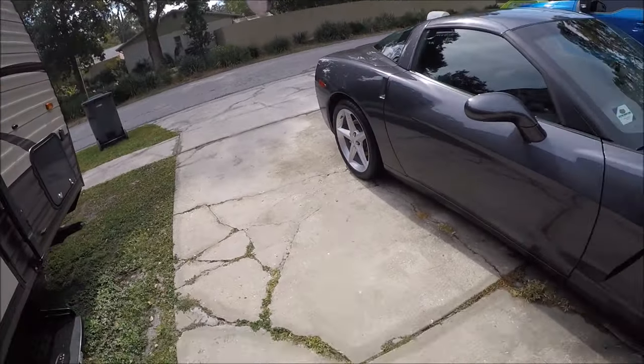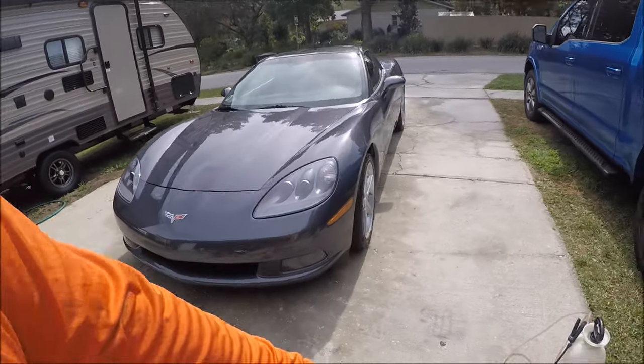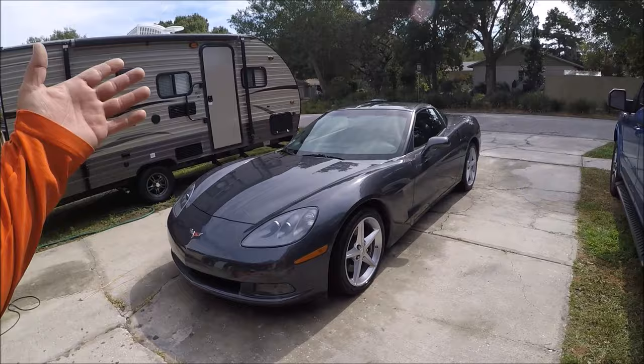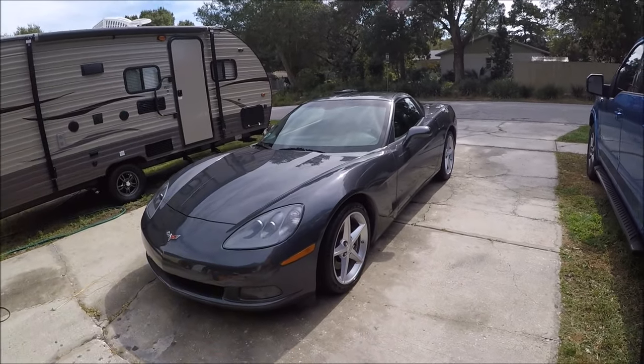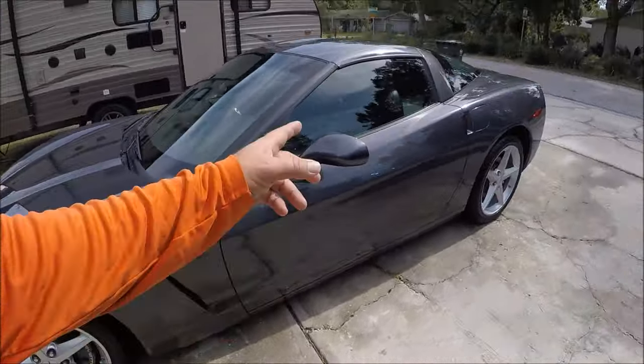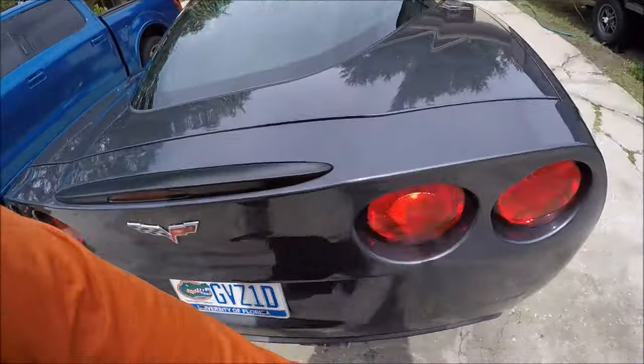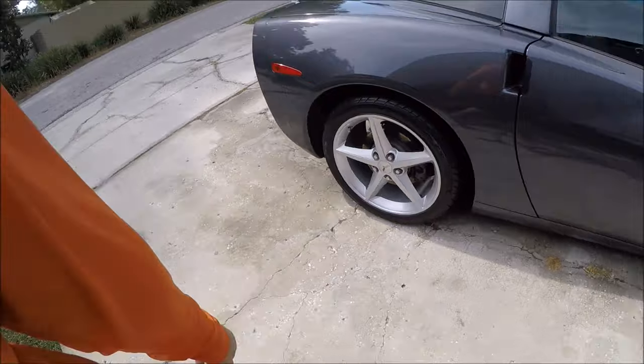She's all done. I just finished the interior — I only did a basic interior: vacuumed it all out, wiped it all down, hit the cup holders, wiped the windows, and hit the door jams. On the exterior, as you can see, it looks amazing. You watched me wash it, clay bar it, wipe it down with Stripper Juice, apply Infinite Force Field to all the paint, all the wheels, and all the glass. I also applied tire dressing diluted 50-50 with water to the tires.